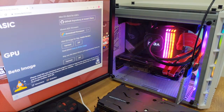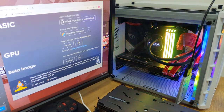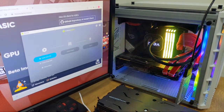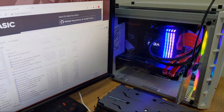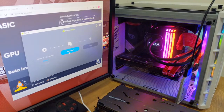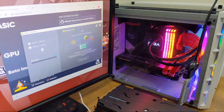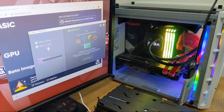All right, what are we doing now? Okay, HiveOS is downloaded. All right, perfect. So we're gonna go make sure you have Balena Etcher. Okay, so here's Balena Etcher, and it's a free download. Very easy to install HiveOS. Okay, so we're gonna flash from file. We're gonna go to my downloads folder, and it looks like the one I just downloaded is right here. Double click on that file, it'll select it. Now we need to select the target, which is gonna be the 120 gig SSD, which is right here, okay? Hit select and flash, and we're gonna get command prompt. You're gonna say yes on that, and it's going to start flashing, okay? There we go. Very easy. Very easy to put on HiveOS.